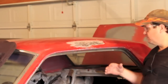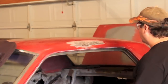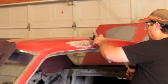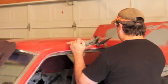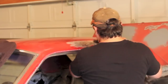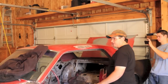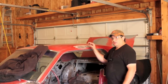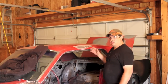So that's important - body lines are your hardest area to get back. You want to try to get those just as close as possible so you don't have to use a lot of filler on your body lines. Now we're going to work on this other low area over here. I might tap that in. And that's feeling pretty good. Now what you want to do is take all the nails off, feel of it, and there may be a low area here or there you just want to pull up a little bit. I think there may be a couple here. The rest of it's feeling pretty good - it's going to take minimal filler.